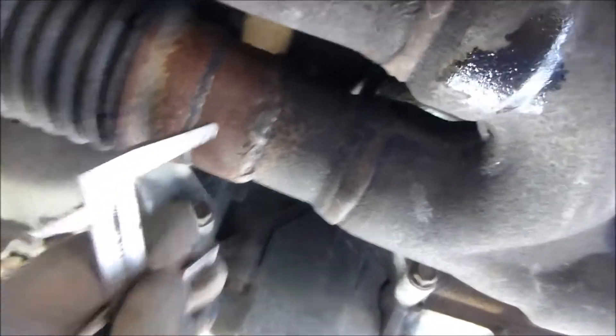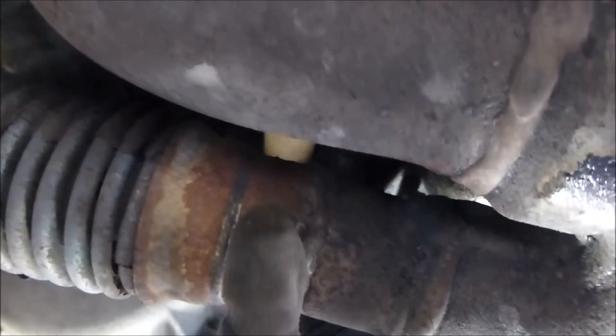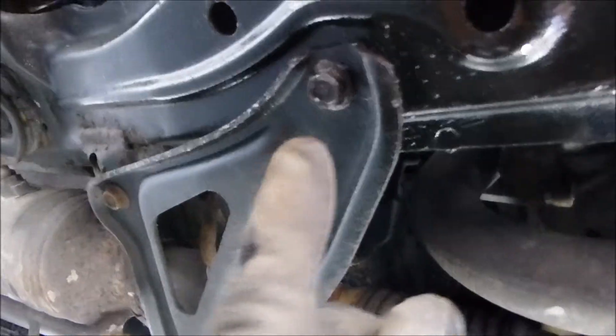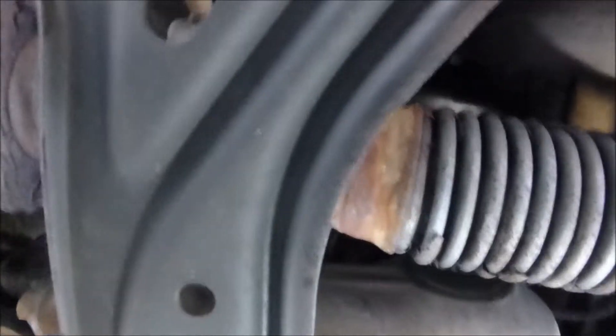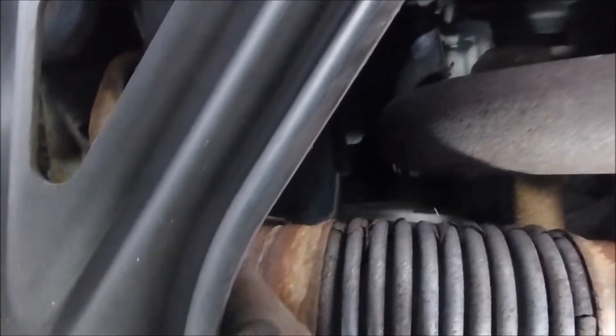I'm going to cut — you see that gray line? I won't cut on the line because it's too hard since this is welded metal. I'm going to cut right beside it and remove this piece right here. There are four bolts: there's one here, one here, and two more here — they're 17 millimeters. By removing this piece it'll give me more room to work in between here, because the camera is right underneath the part.